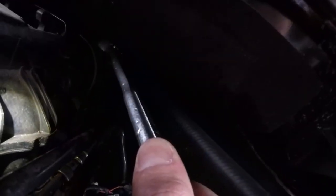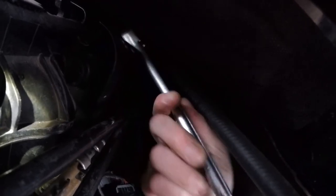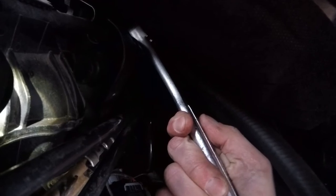It's beginning to tighten here. I'm making sure I'm at a good angle with my universal and everything, and I'm going to give it a good snug — not too much, but just enough to crush that fitting. That feels pretty tight. I'm pulling the extensions out. I did not remove any hoses, unplug anything, or move any shields, and there she sits.